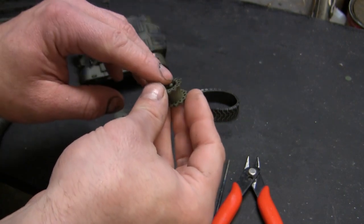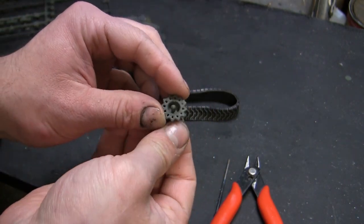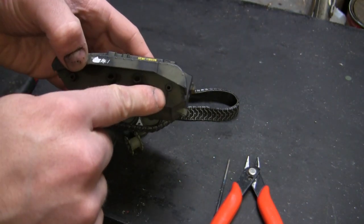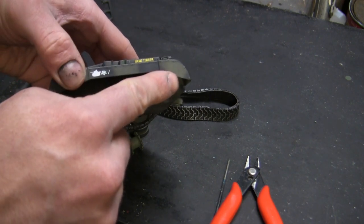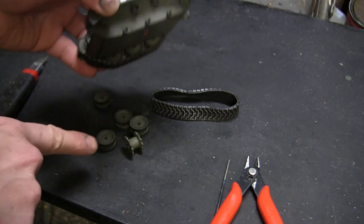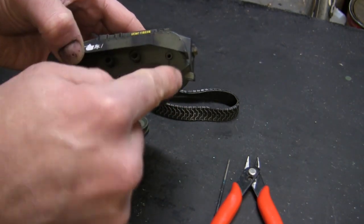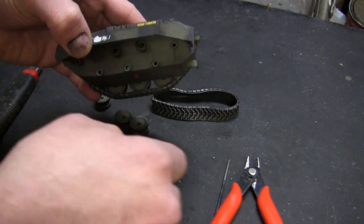Once the peg is able to be slid into the sprocket, I'm going to temporarily leave it in this position, like the way you see it here. You see, when it comes time for inserting the peg into place, it's going to be a little tricky to work around this portion here of the fender, so by having the peg in the sprocket, this allows you to then just push the component in without having to muscle it in and trying to align everything by hand.